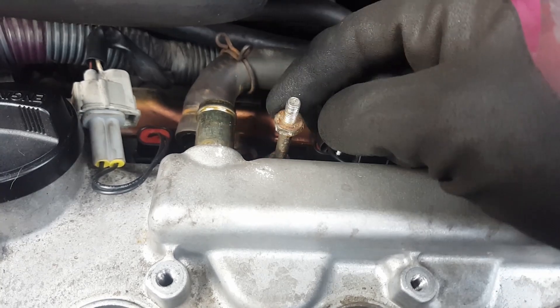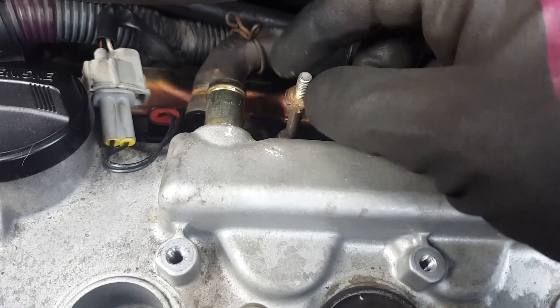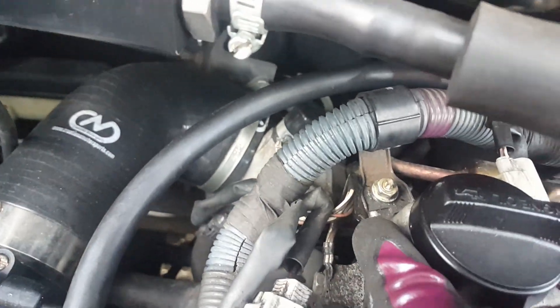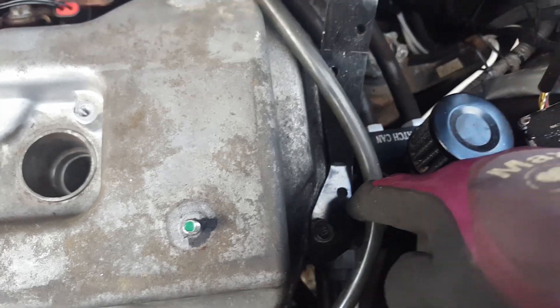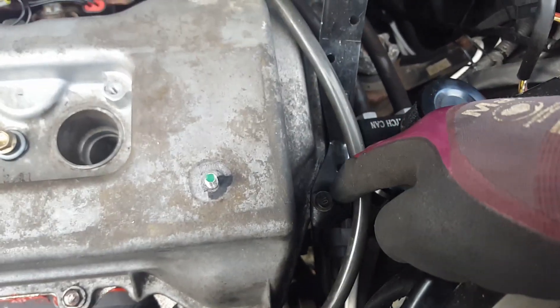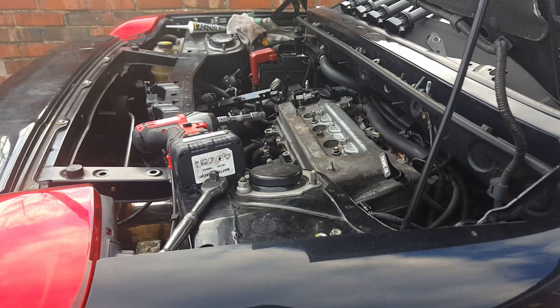Just something quick to note — this one over here is 12mm, so get 12mm on top of there, crack it open and there it comes. The rest are all 10mm. The ones holding brackets are nuts, so that one and that one are 10mm. And that one there holds the dipstick bracket — mine's obviously modified but your stock one will be held on by that 10mm as well.